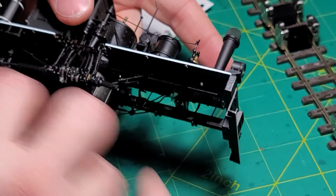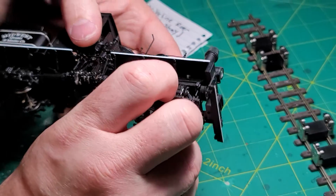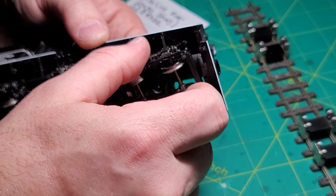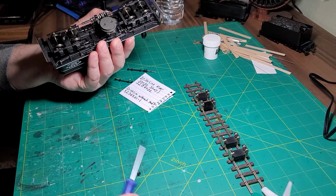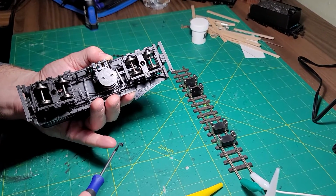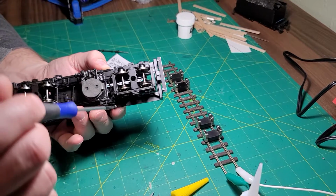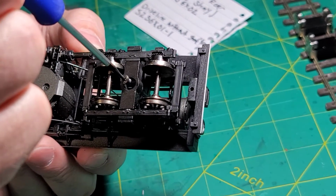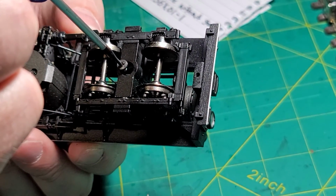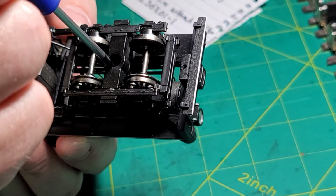You put it inside the slip joint first, and you orientate it around, get the journal lined up, find your screw, and it's kind of like the opposite game of what's that? The Operation game where you have to take those bones out without touching the sides. You kind of have to do the opposite of that, because as the screw's going down, you bump into it, it messes up the screw and it doesn't line up. Like I said, I've had this take 10 minutes, or it goes in relatively easily, just like that.